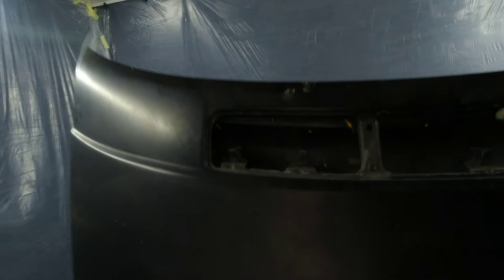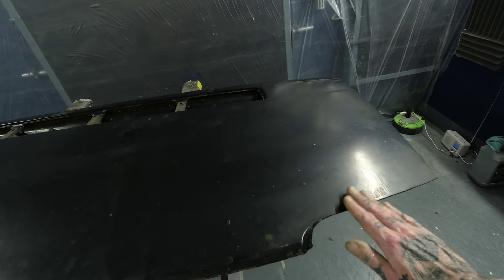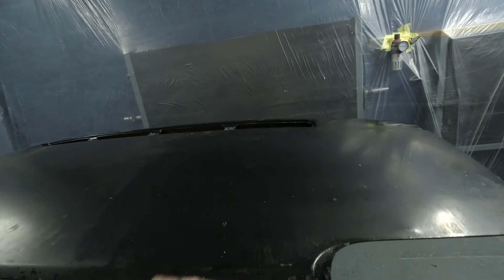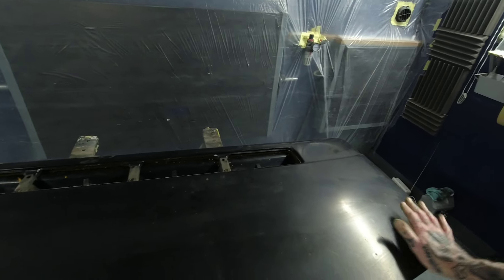When it comes to that dent, I'm basically going to get a flat piece of square steel bar and just tap very lightly so it goes down - just so I don't feel that bump. Get it as flat as I can. This is a very old van with a lot of prep work to be done. It's a collab with Dude Stuff - we've done the bumpers brand new, painted in Nardo gray. We've got chicano-style artwork going on this: the Dude Stuff logo, chicano airbrush artwork, Nardo gray blending into the artwork, then clear coat to finish.